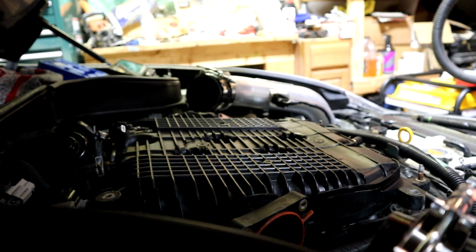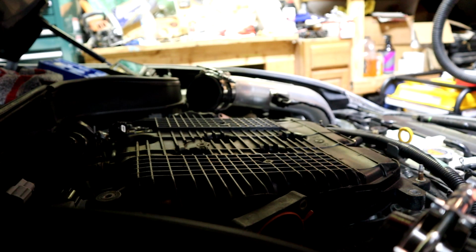Alright, so we have the bolts in place, so now we are going to torque down the bolts to 14 foot-pounds. And there is a sequence to doing this. I'll put a link in the description to the video that shows you how to do this. It's actually a really good video on how to install these manifolds, but it'll tell you exactly what pattern to tighten these in. I actually have it pulled up on my phone over there. And what you do, tighten it to 14 foot-pounds.